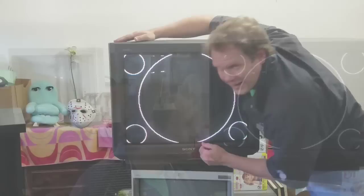I also made a couple of other errors. I kept referring to this as a monitor — it's really a television because it has a built-in tuner — though it functions almost like a monitor from that era. Another thing I said was that you can't adjust the convergence; that's not quite true. You can use the rings and adjust around the yoke, though it's very tedious. I did that and put epoxy on it so I wouldn't have to deal with it again. There's just no convenient knob like BVMs and PVMs have for full-screen convergence adjustment — that's a feature of higher-end monitors.